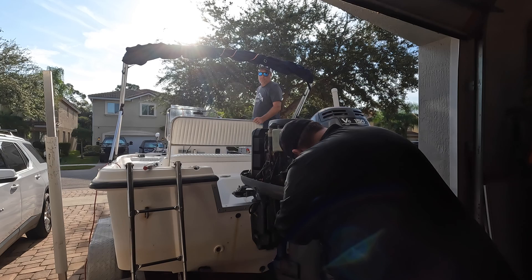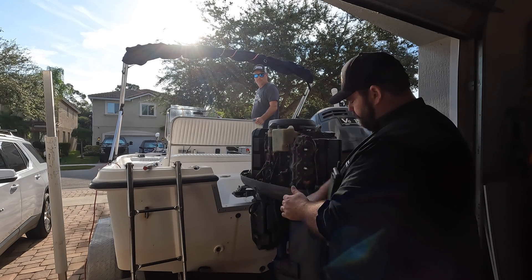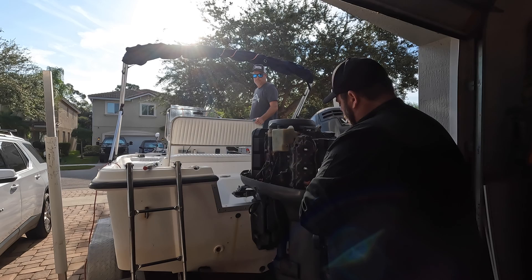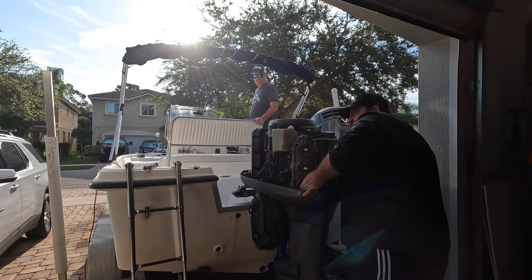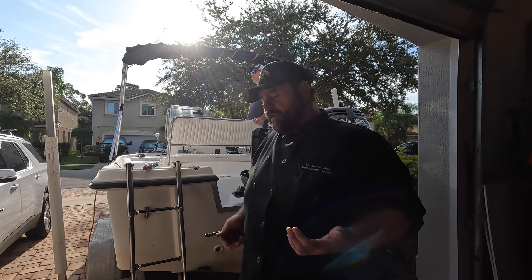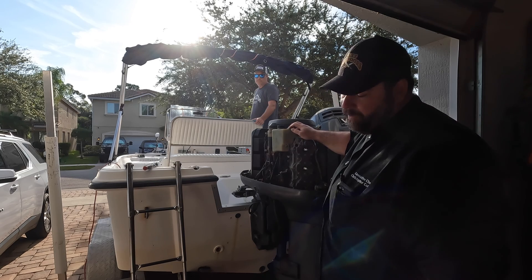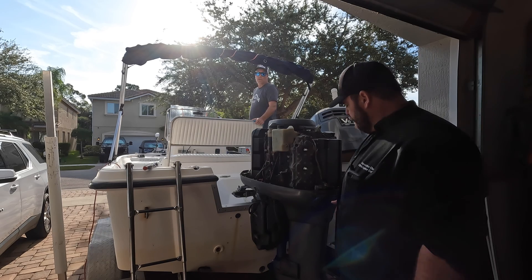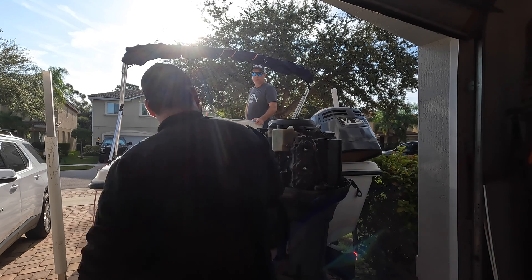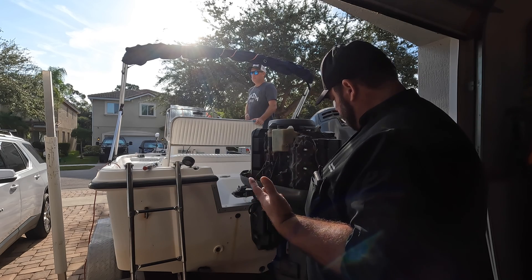That's not bad — 95 to 100 pounds compression, that's not horrible. So that cylinder is not gone. Let's mark it at 95 to be safe. That could be a slightly elevated reading because I did put oil in there — oil fills the grooves and provides better compression. Also, if an engine has been sitting for a long time it could give a bad reading and just needs to be run. This engine runs all the time, so that's less of a concern.